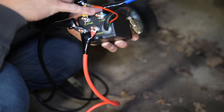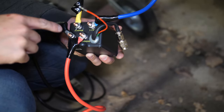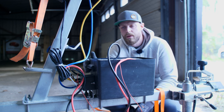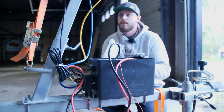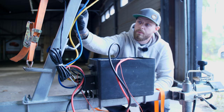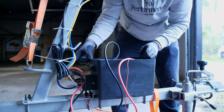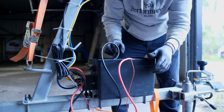From the winch down to the relay: blue goes to blue, yellow goes to yellow. On the battery, red goes to plus and black goes to negative. I made sure we had a full battery and attached the relay on the backside of the battery box. Now I'm just going to use cable ties to secure the cables from the winch on the tower in a better position. These cables are far too long — we're probably going to use maybe 40 centimeters at most.